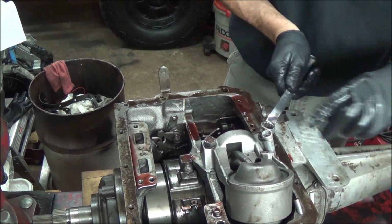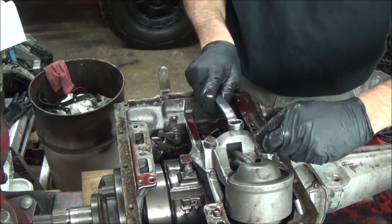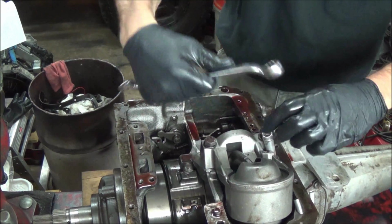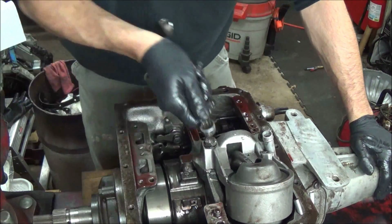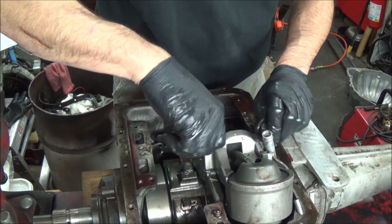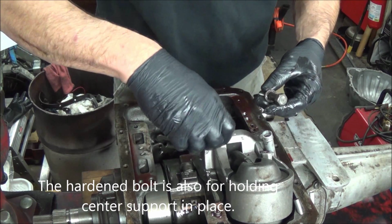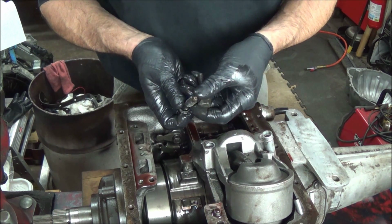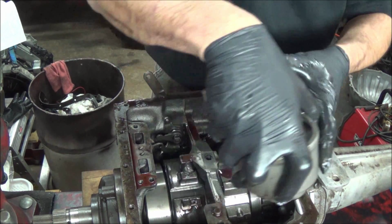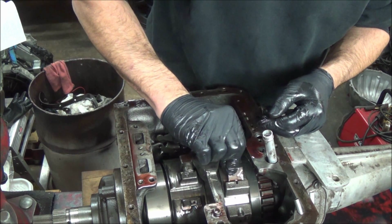So, the rear servo. It's kind of weird. The one bolt looks like a grade 8 designation, and the other one looks like it came out of a hardware store. But that's probably normal. It has like an anchor pin on the end of it. And of course, another strut. This one, the notch goes into the rear band.